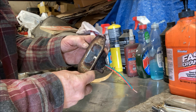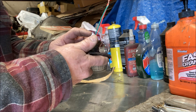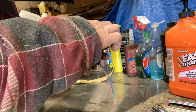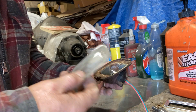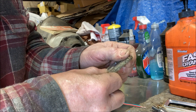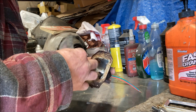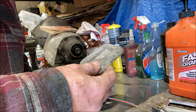We've got a light bulb. Sealed up the back with butyl tape — electricians call it monkey snot. You can use RTV, whatever, just to keep water from getting in there and corroding it. The lens sits in there like that, and you can see where the original gasket failed on the back. I'm going to use some foam insulation tape with the sticky side back, wire wheel the housing up a bit, cut the foam tape into strips to make a gasket, and put it back together. That way I won't have to worry about this failing again.